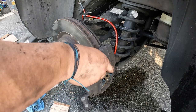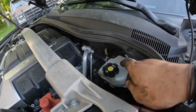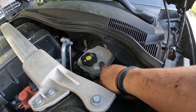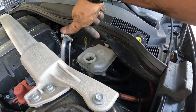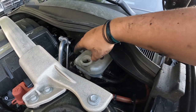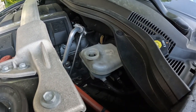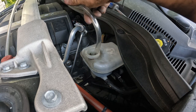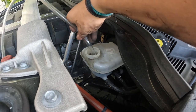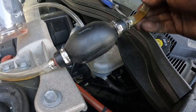Next we're actually going to replace the reservoir. It doesn't need replacing, but I'm going to get all the fluid out of here and swap the plastic assembly. There are two screws on the side — take those out, take off the whole white plastic assembly, and I've got a new one to pop in. To drain it, I'll use one of these little hand siphon pumps — jam this down to the bottom and work your hand pump.